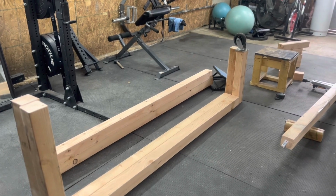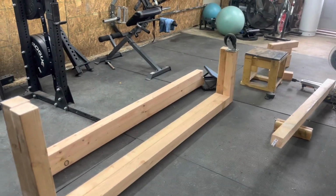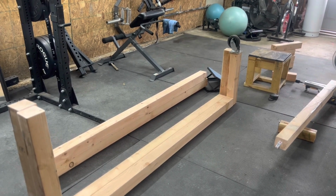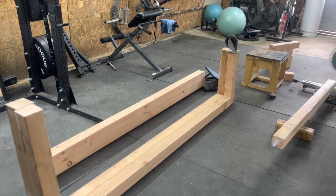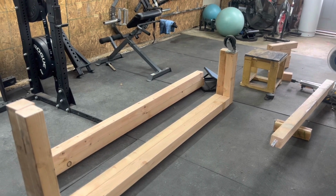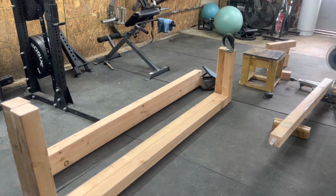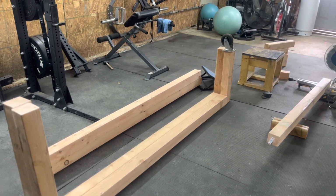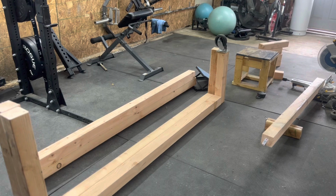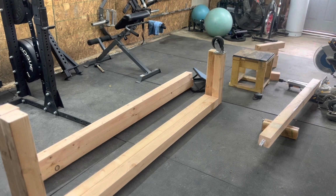So what I'm doing, though, is I went 1 inch higher. I went out and measured the wheels, so I'm taking into consideration my rims so it can slide up under. Right now, I have 22-inch rims. I didn't think Buddy was running 22-inch rims or anything like that. I'm gonna guess and say maybe 20s, at the most, and that's just me thinking. But I went with the extra inch, even though I know the casters are like 6 3/4 inches and that's gonna bump it up a little bit more, because I wanted to make sure it was high enough that it's gonna clear and I don't have any issues.